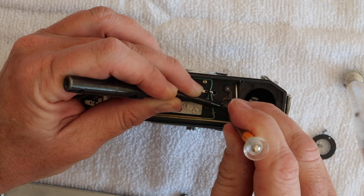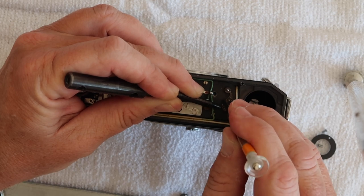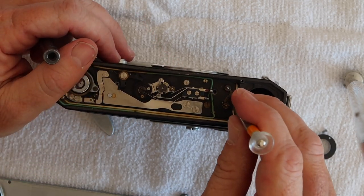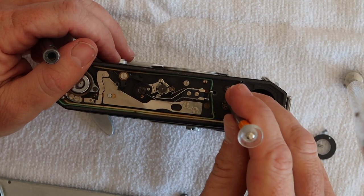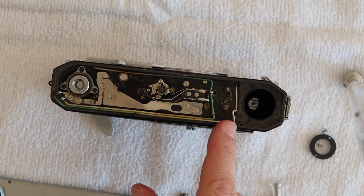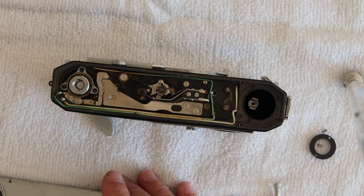Once you've turned it about one-eighth to one-quarter of a turn, firmly push the sawtooth gear counterclockwise, pull the locking pawl or arm back against the sawtooth gear, then tighten the locking screw. By lubricating the intermediary shaft and adjusting the lead shutter curtain, this will greatly improve the accuracy of all the shutter speeds in the camera, including the low shutter speeds.